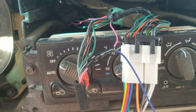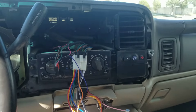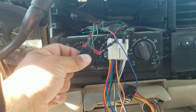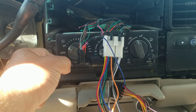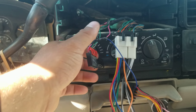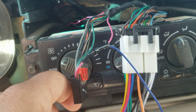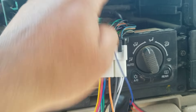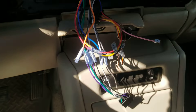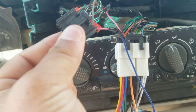This pink wire on the extra connector — you connect that blue wire to this pink wire and you get sound from all speakers. So instead of having to go buy an adapter, which around here runs about $80, and having to find room for two big blocks inside the dash, you can just bypass it by connecting that one wire.